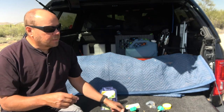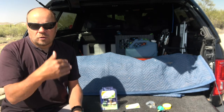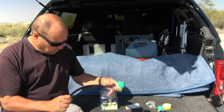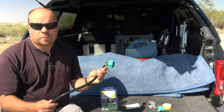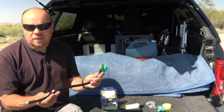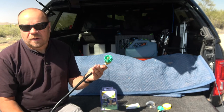On an Airstream, unfortunately, because of the front tanks being in an aluminum enclosure, we have to change the hoses so that they have a 90-degree bend on them to get more clearance for the device. This is also something you should do on a periodic basis anyway — these hoses tend to fail; they'll dry out and crack and then start to leak. So it's probably a good idea to replace them maybe every five years or so.